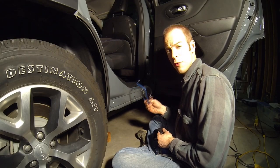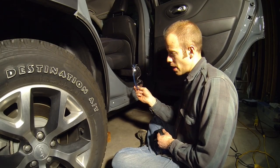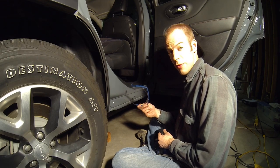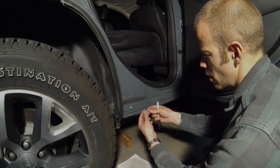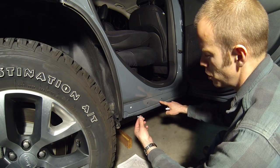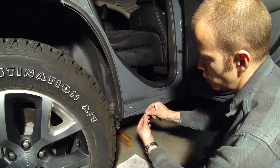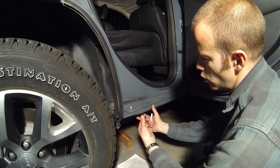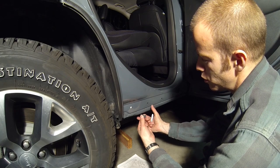Since we're drilling metal, don't forget to protect both your ears and your eyes, because if you get one of those metal splinters in your eye, that could definitely ruin your day. After drilling the holes, we're going to go ahead and mark the ones that we're going to use and install the nut certs, which hold the bolts, which hold the rock rails onto the rocker panels.